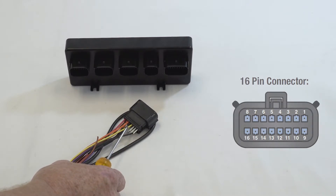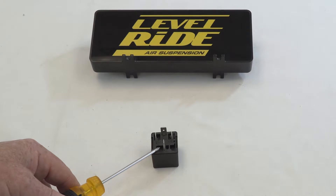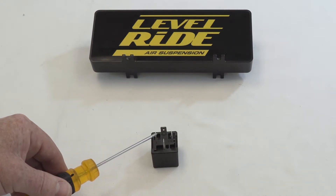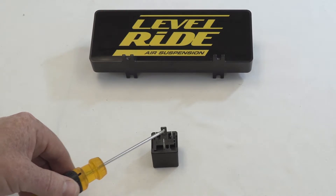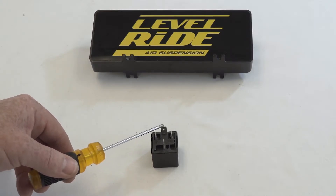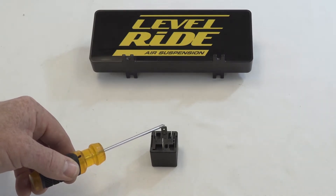We'll go through the relay wiring and our preferred way of wiring a relay so it works with the level ride system. This is a relay — it's not supplied in the kit, but this is what we recommend that you run for a compressor. We recommend that you run a four-pin relay, not a five-pin switching relay. The relays are all wired in our preferred method where the 30-pin or main pin is direct to the battery via a fuse. The 86-pin comes from the yellow wire on the main harness of the ECU, which is your trigger wire. The 85-pin on the opposite side is an earth wire. And the 87 on the top is either going to your compressor, or if you have multiple compressors and you're using this to trigger the relays for the other compressors, this would go to the trigger point of the other relays.